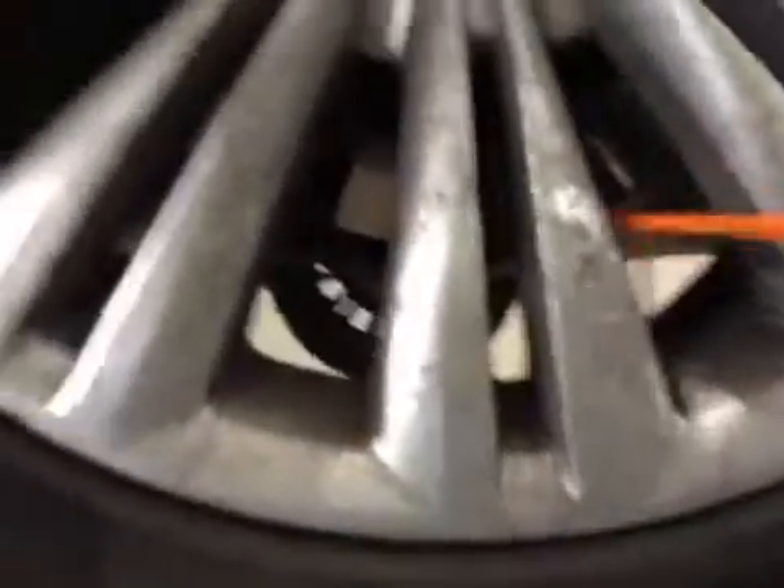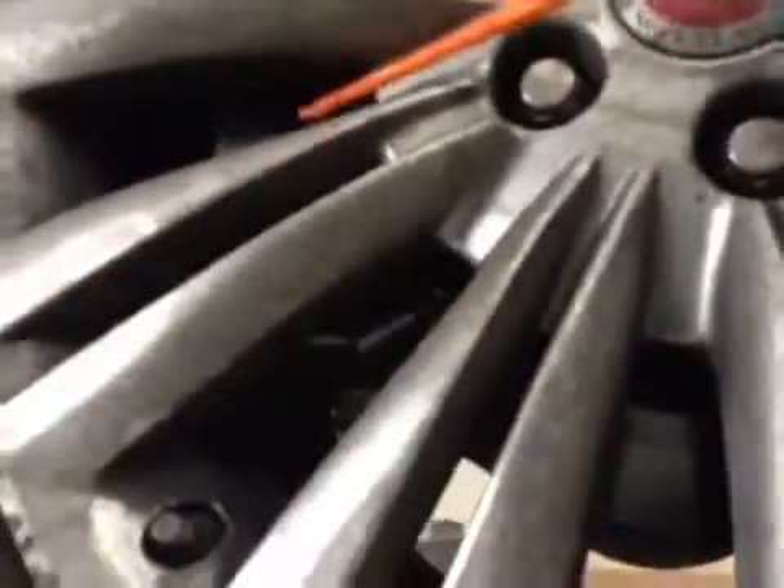The exterior is in amber. All the passenger side rear suspension is all looking okay. This is the passenger rear tyre — it's just over 5mm for tread depth. Looking at the side of the tyre, the rear disc is in okay condition and your rear brake pads are on 8mm.